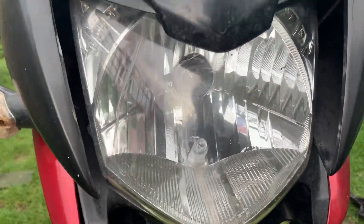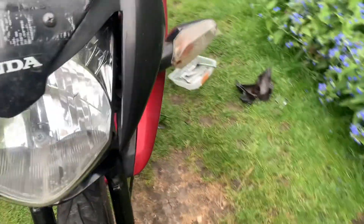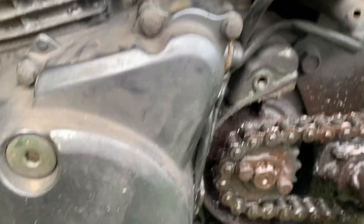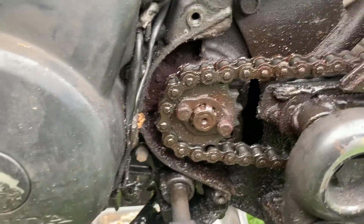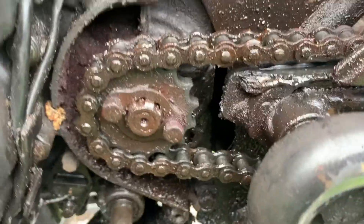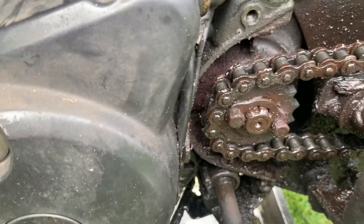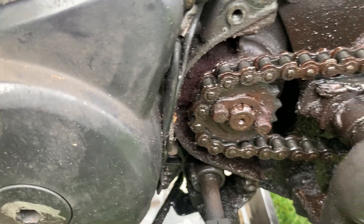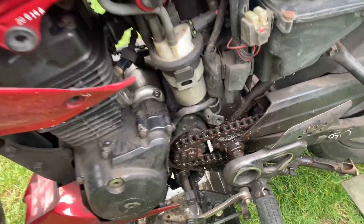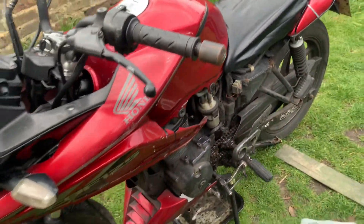You can see it's got just a host of problems. The headlight is broken, the panels are all cracked, the front mudguard is missing, and these forks are completely toast — they're no good at all. But probably the worst thing is there's an oil leak somewhere in this engine. If I can't fix that oil leak or understand where it's from, I have no hope at all. It's just all over the place in here. I'm going to have to get a big bucket full of petrol and a big scrubbing brush and try to melt the oil and crud out of there.